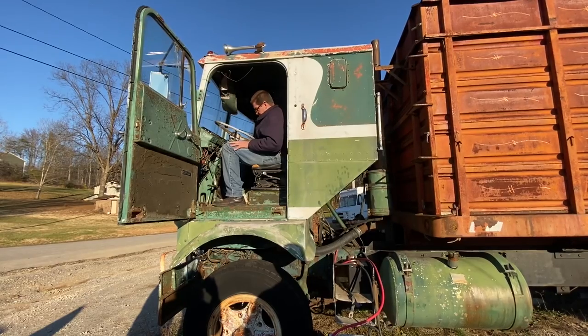Okay, we are back in Franklin, Tennessee. We finished that job and came back down here to finish up on Lance's bus and Bill's bus. So we got that cracker box going. There's a couple little issues with it. Number one, the previous owner had an auxiliary priming pump hooked up on there, and we soon learned why. As we were having fuel starvation issues, we'd shut it off, and if you waited more than like 5 minutes or so, the fuel was just running out of it, depriming the whole engine. So they had that little pump on there to keep it primed.